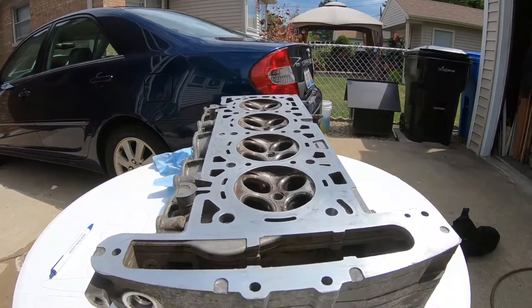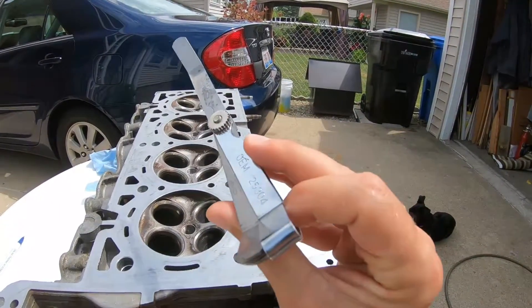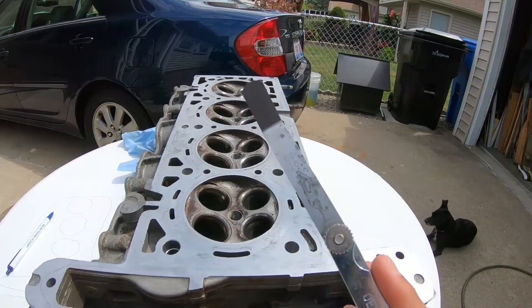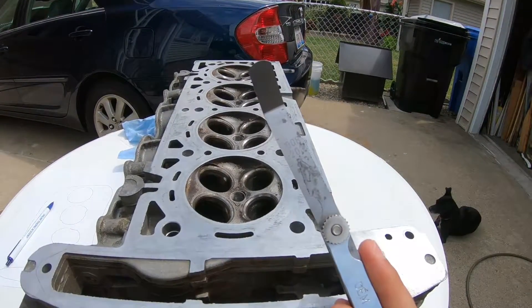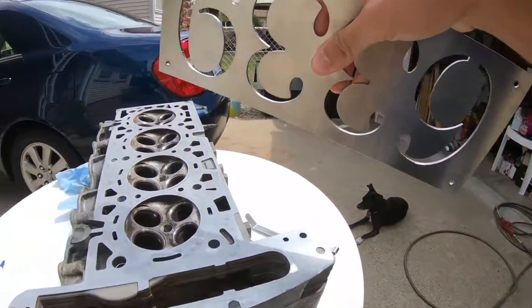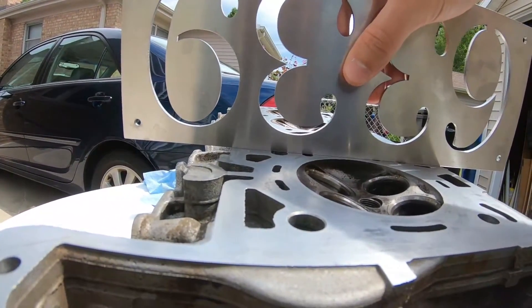For this kind of procedure you're going to need a set of feeler gauges with multiple thicknesses. Right now we're going to be using the smallest gauge here, which is 0.008. You're also going to need something like this — a straight piece of metal that you can place on the head.